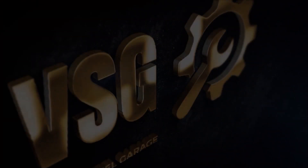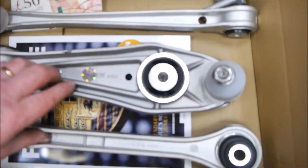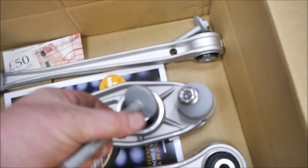Welcome back to the continuing episode of the Porsche 911 where we're working on the rear suspension so we can take it to get the four-wheel alignment done. We need the nuts for the toe - also called tracking - and the camber to be adjustable. At the rear we're adjusting those camber bolts; one side was fine but the other was completely seized. We've got the rear track control arm, the lower suspension arm also called a coffin arm, and another track control arm - three items to replace, along with the eccentric bolts.